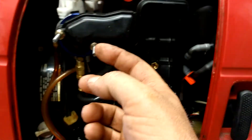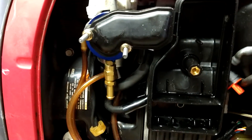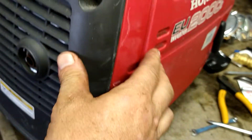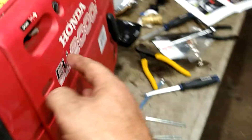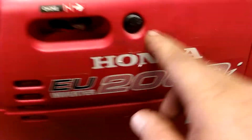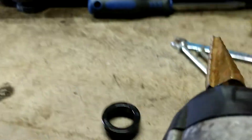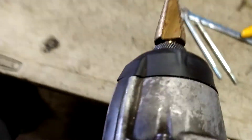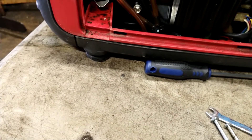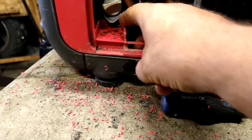It doesn't say to do this, but it's the only way I can see this cabinet closing. I'm gonna cut these extra studs back off. I put the cover on to see if it does close — this sticks out just a little bit where it's touching, but it does close, so that's all fine. I'm gonna take this back off and drill a hole right here, that big around. I got these bits here — it's not gonna be big enough but once I get in there I can widen it out a little bit. Be careful you don't go too big. It clicks right in to the hole.